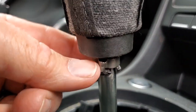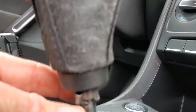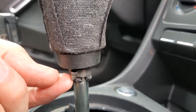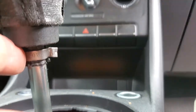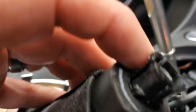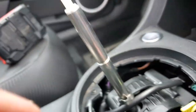There's a retaining ring here that keeps the detent. That's part of the detent, that's part of the metal shaft. Pull that ring loose and it won't hold it in there anymore — you don't have to try to yank on this like crazy; it'll just come right off. Just work it until you can get it loose. It's got a ring that sits down in there — that's what's holding it on. Get that ring down to the bottom and this whole thing has to come off.